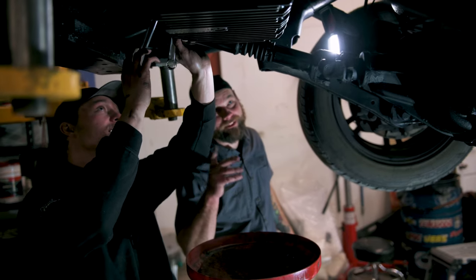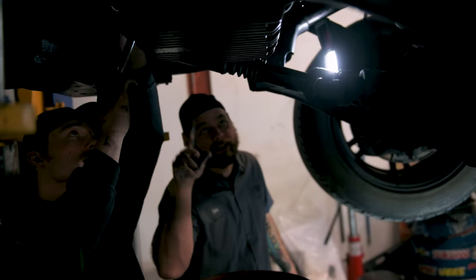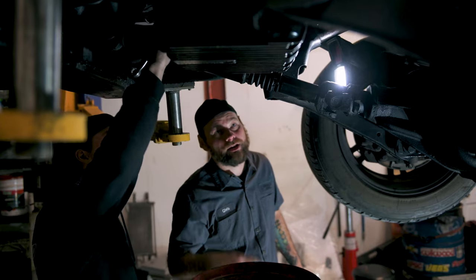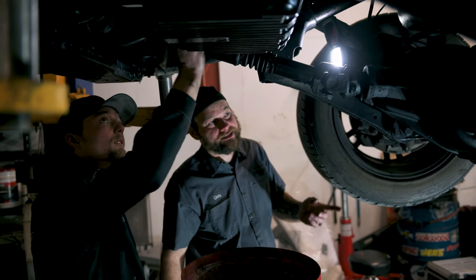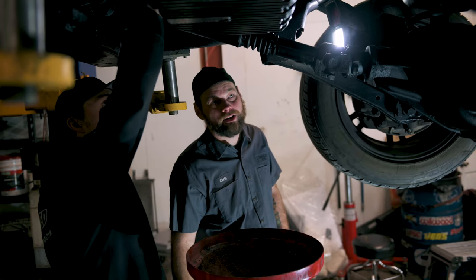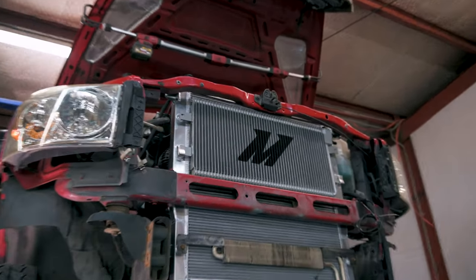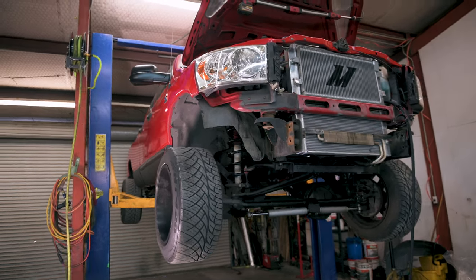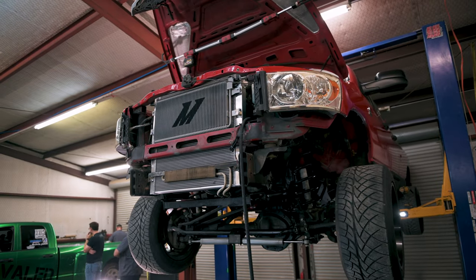What we're going to do is delete the factory lines and the factory coolant heat exchanger on the side, and put in quarter-inch MPT to dash-eight fittings running Aeroquip push-lock hose all the way to the cooler. It's serviceable, quick and easy, long lasting — you never run the risk of cross-contaminating coolant and transmission fluid via the heat exchanger — and overall higher flow and less hassle. Mishimoto, please sponsor me — your trans cooler looks sick especially in front of my aluminum radiator.